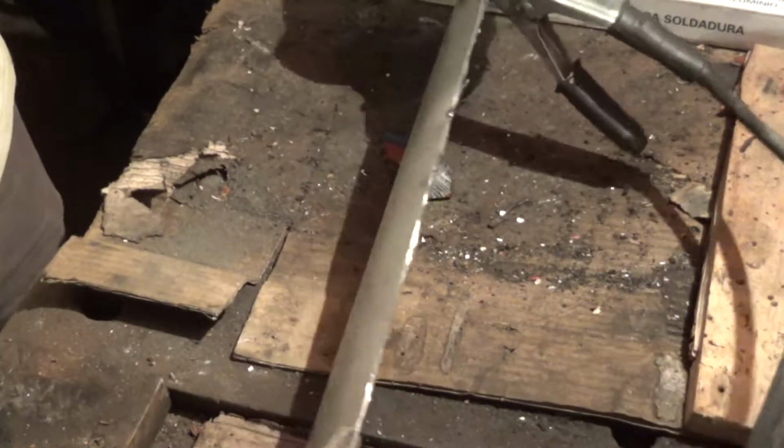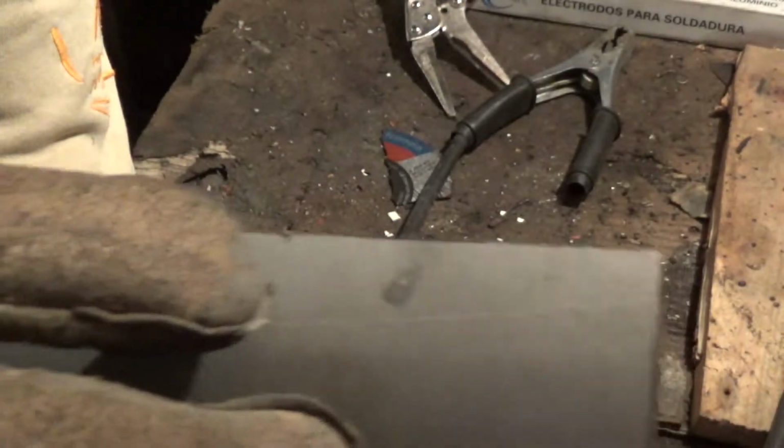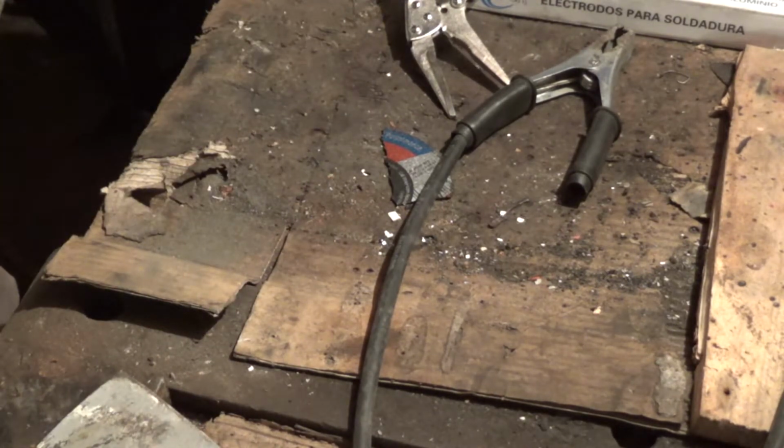And as you can see, the weld penetrated to the other side. Here you got the different color, means it penetrated, so both are staying together. This then makes it easier for me to fit it back in place. I think I gotta push a bit more. It's not strong enough. I'm gonna push a bit more and it's gonna be okay to weld.